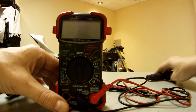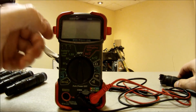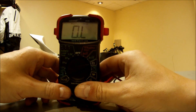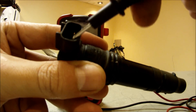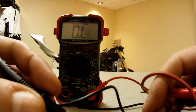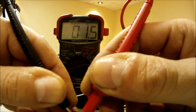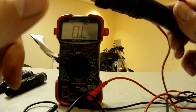I'm going to put it like this so that way you can see. First, I'm going to measure primary resistance on the factory coil. I'm going to set this to resistance, then I'm going to take the probes and measure resistance between this pin and this pin. All right, so we've got 1.5 ohm primary resistance on the stock ignition coil.